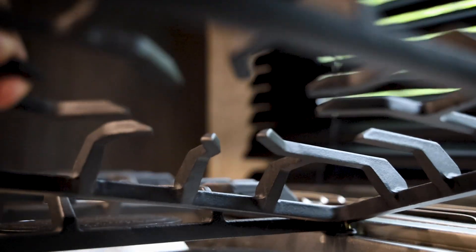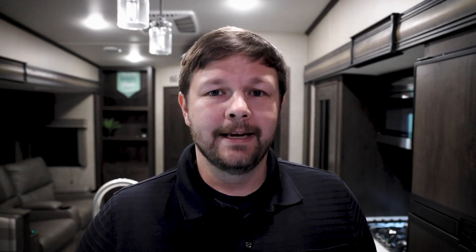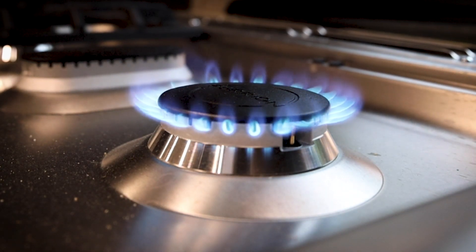Check your propane. Make sure that the tanks are topped off. Make sure that the lines are working properly, that your stove and your oven will turn on. If you have an RV refrigerator that runs off propane when the electric is turned off, go ahead and kick that on. Make sure that it's working appropriately, and that way if something isn't, you have a little bit of time to call someone in to help you out.